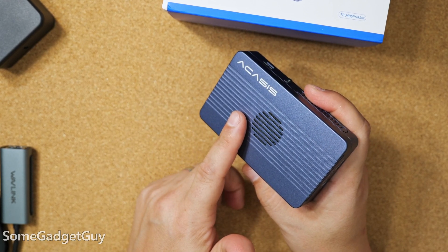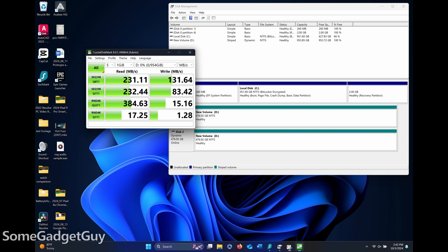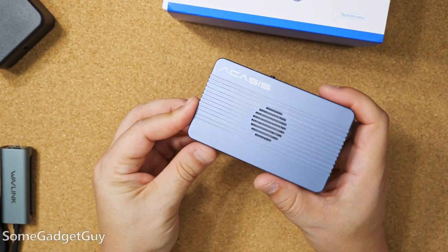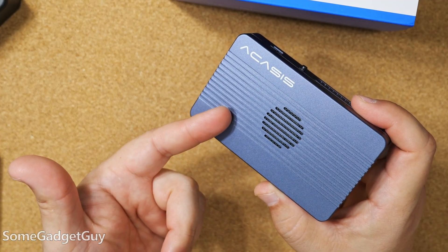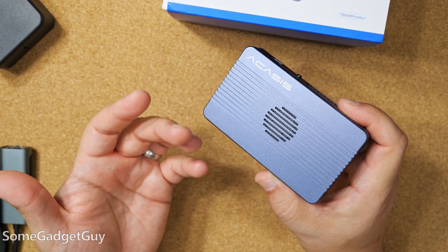That said, it's still pretty fast. Here's one of the things I don't quite understand: I installed these drives, ran a bench, and got some pretty good speeds. Then I striped the drives and running the same bench, I got terrible scores — but actual file transfers were noticeably faster, peaking at around two gigabytes per second with a much higher sustained transfer rate than what the test bench was scoring. I've run several permutations of this transfer and bench and it just seems wonky. So I'm legitimately asking my audience: what might I be missing if I'm trying to rely on a synthetic benchmark but can actually demonstrate practical real-world speeds that are better than that synthetic benchmark? I'm pretty sure the drive is doing what it needs to, but I'm doing something wrong trying to test it.